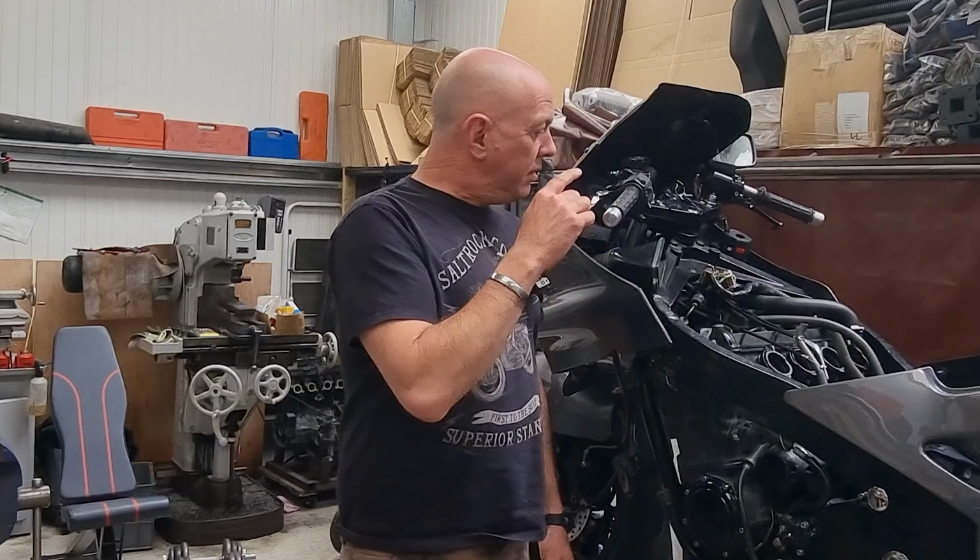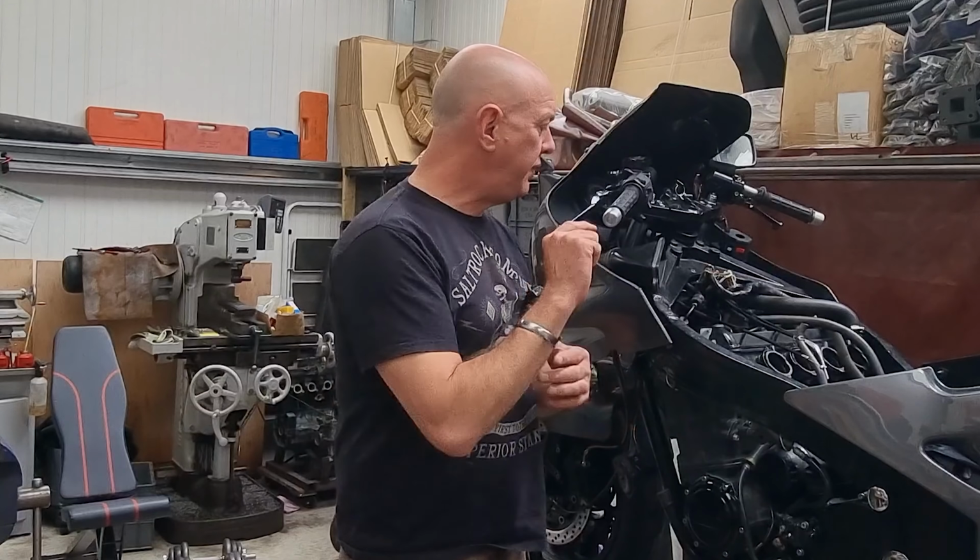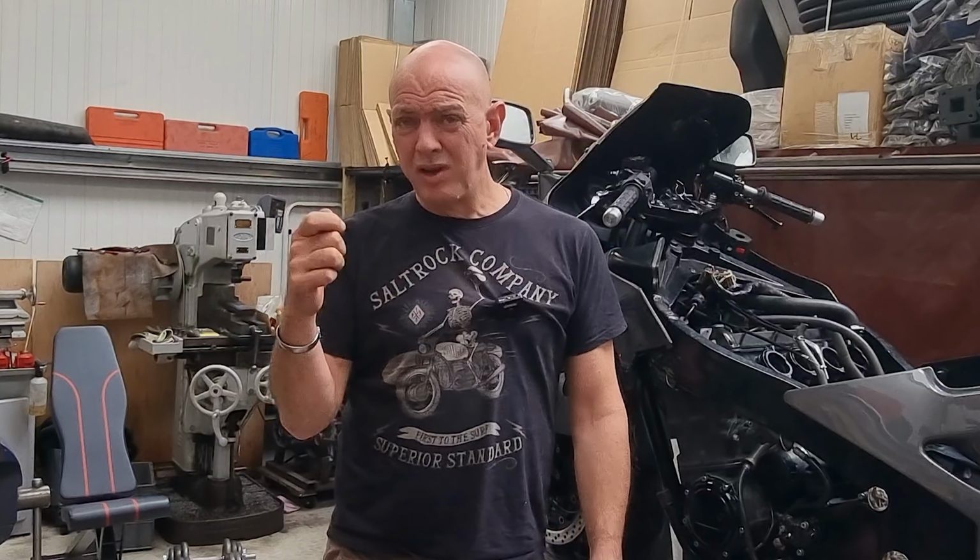The spark plugs, I have switched them about as well. Because it was running lumpy and horrible, not running at all on what is cylinder 3, the plug in that one has been switched over with the one in cylinder 2. I'm pretty confident it's not a plug. People say they've had brand new NGK plugs fail, and some people are saying there are loads of dodgy fake ones out there as well. But I didn't see that when I switched it over. I've got some more plugs coming actually, and they will fit this. They're for something else, but I will try switching it out with another brand new one and see if that helps. The coil is getting replaced.